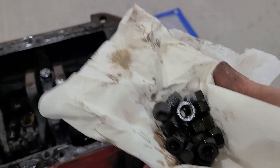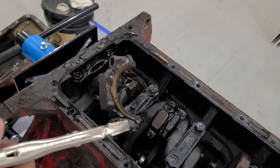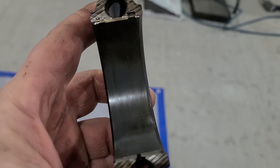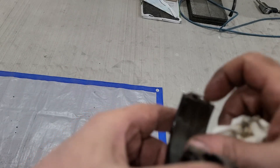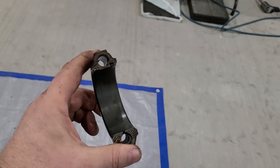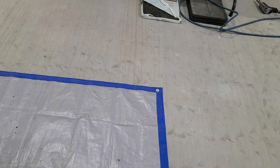I didn't round or strip the corners of any of them. There's the first cap — let's get a closer look at what's going on in here. That looks good. Of course there are those little scuff lines, they're pretty normal. It's pretty standard. There's definitely not an edge you can grab a nail on or anything, and there is no rust. With any luck the rest of those will be the same and that crank will be original size and I can just reuse it.